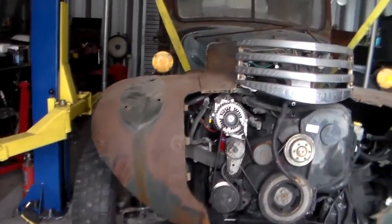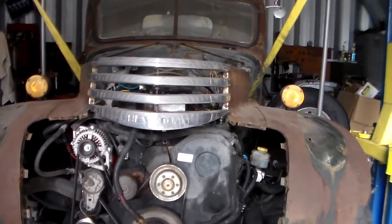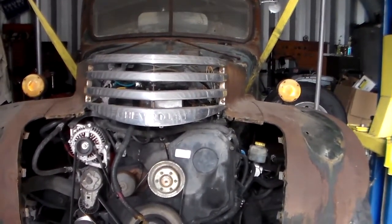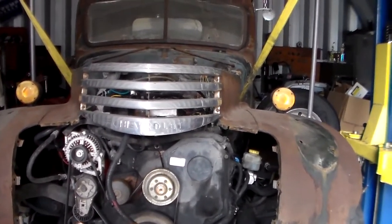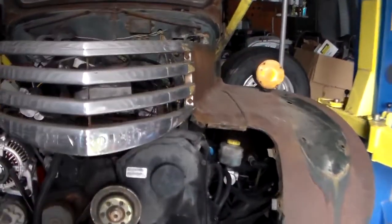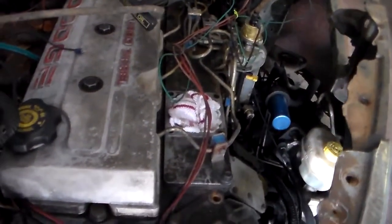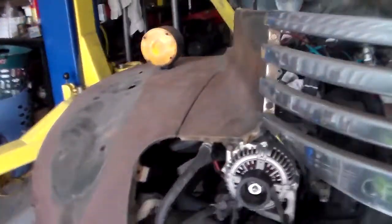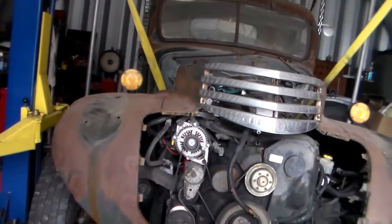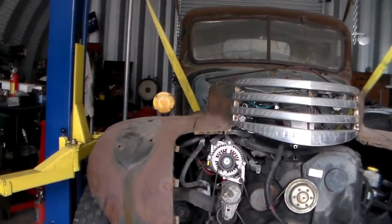I don't have a lot of room — I'm going to have to relocate the alternator. My throttle is nothing to it, I mean we can mount that thing pretty much anywhere. I can actually mount it on the firewall if I want, or back of the motor. I'm going to have to build me a horn, which shouldn't be too awful hard — I'll figure it out. And the turbo is going to be awfully close on the clearing. That's probably going to be my deciding factor on where the cab's going to go — where the turbo's going to hit the fender.